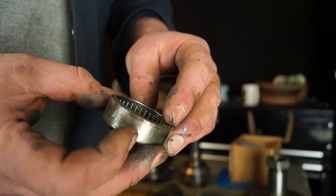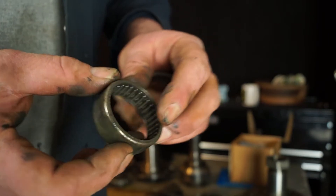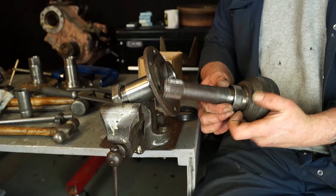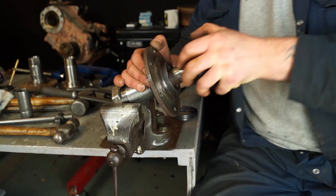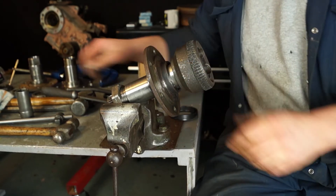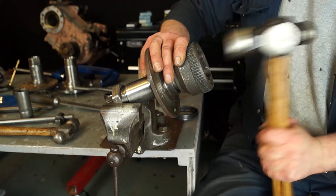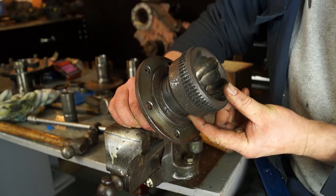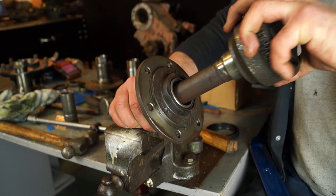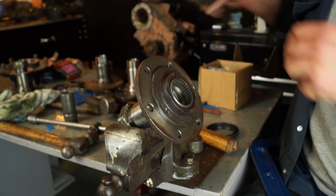This type of bearing is very delicate and it needs something packed out in the centre so it doesn't drop the bits. The best way is to use an old CV joint or even a current one and position it. This way it can be knocked in fairly accurately without damaging it and it doesn't actually take that much pressure to push it in. What we'll find, though, is that this joint, once you've got it up to the collar, it hasn't gone all the way home.